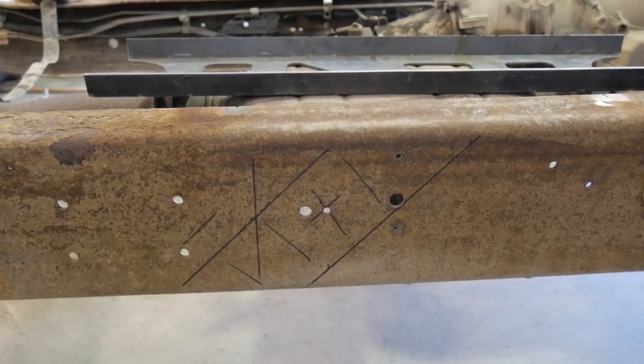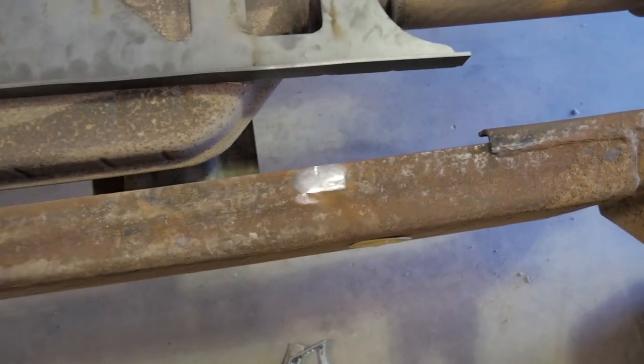I've just laid everything out. I've got my frame cuts in a nice open spot where access is easy. I actually have them going the opposite way on either frame rail — the theory is that any stress won't be in the exact same spot on each frame rail, hopefully limiting any remote possibility of something happening. I've marked it at 16 inches in a nice easy spot to measure. Once it's cut and chunks taken out, I can just use those same marks to measure 10 inches. I've notched the frame with the cutting wheel instead of just having something that can wipe off. So there's not much left to do other than bite the bullet and do it.